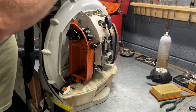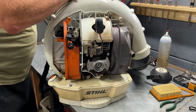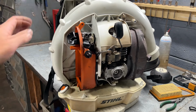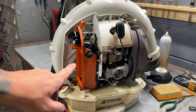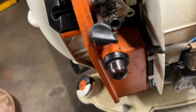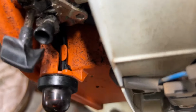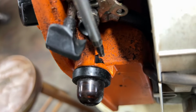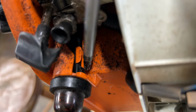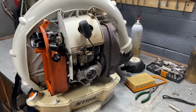And now we're gonna be over here. Should have used my other table for this, but it's tied up right now with an engine on it. Okay, here's your primer bulb. I'll get you in here so you can see. There's a prong. There's 2 prongs on it, but we're gonna be pushing down on this prong, squeezing it in to get it to unclip. And I'll get the new one and show you what I'm talking about.